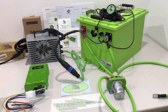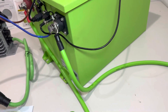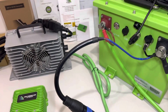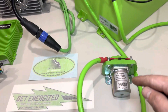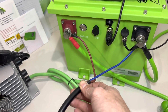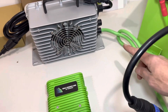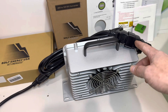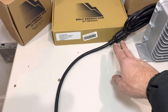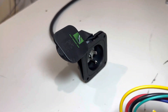I've put everything together as it would be set up in the cart. Your new negative two-gauge cable is going to run to your controller, and your two-gauge positive is going to run to your replacement solenoid. Next we have the battery connection piece to the charger — I went ahead and plugged that into the charger output wire, and then the charger input wire I hooked up to the long cable here.